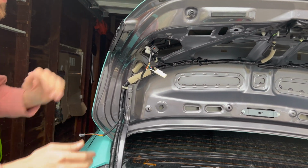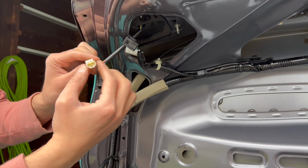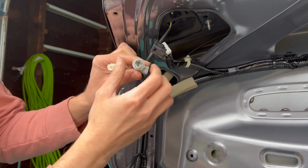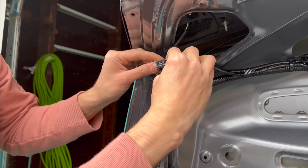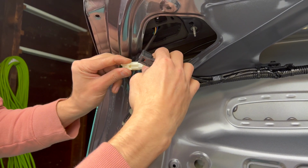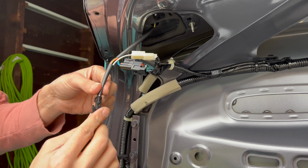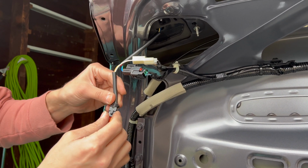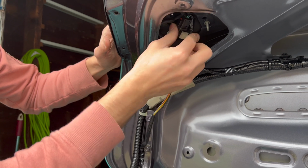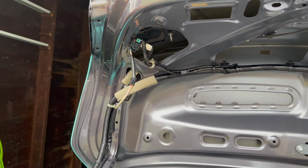It's so dirty out here. Yeah, just dirt. All right, so make sure the connections are in the bottom right there. And it looks like that's gonna be the reverse. So it looks like the stock ones have to come off. Usually a bulb up there. So this socket has to come off. And then that should go in for the reverse. Make sure that goes one way. Yep, fits one way. Plug this guy in and connect this one right here. That's that. And then yeah, you can definitely just put it on the side right there in the corner. It's fine. We gotta put the liner over it anyway. Let's do the other side real quick, and we'll see how that looks.